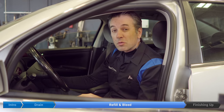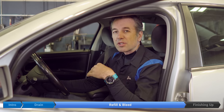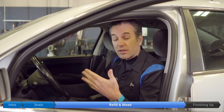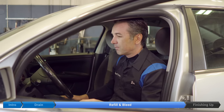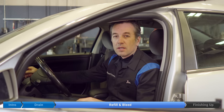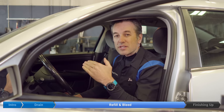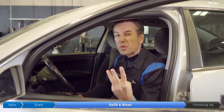Okay, we're coming down the home stretch. We're going to start the car and take it to 2,500 RPM until the engine comes up to temperature — that confirms the thermostat is opening. We'll also get better confirmation that the heater in fact works. We have the car up to temperature now and the heater is nice and warm. The very final step: take it to 3,000 RPM for four seconds, back to idle for four seconds — do this three times.